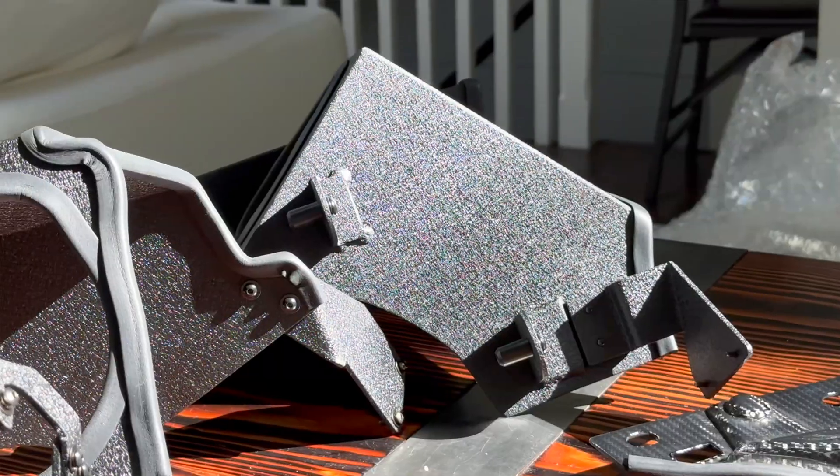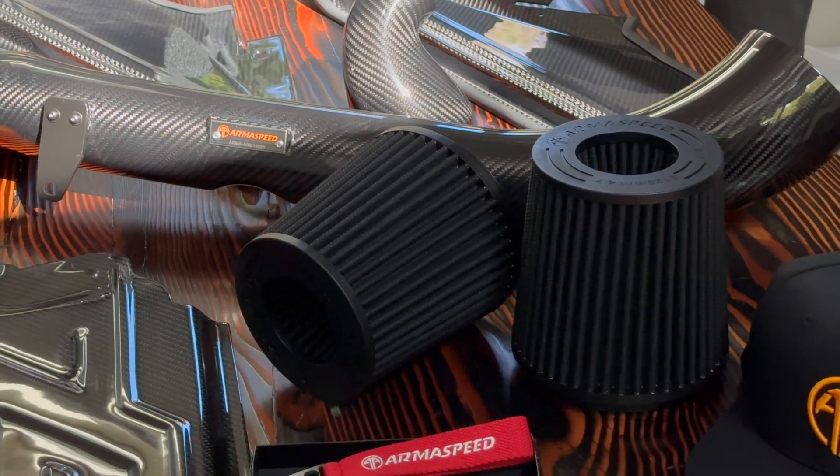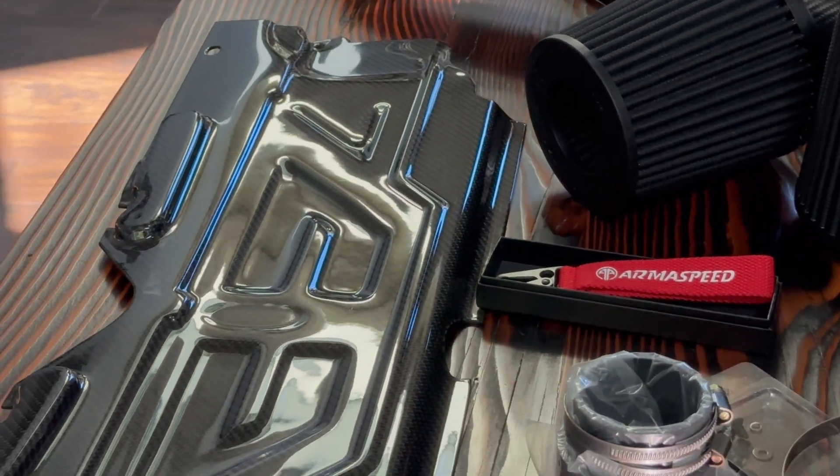I haven't seen a lot of people do reviews of cold air intakes. They talk a lot about the swoosh sounds that you get from the intake, the engine bay enhancement that you get with all this carbon fiber, but none talk about the cold air parts. So why cold air? Why is Armaspeed touting cold air specifically? Well, the idea is simple: cold air has a greater density of oxygen than warmer air. So if you're shoving air into an engine for a given cubic foot of air, colder air is going to have more oxygen, giving you more complete combustion. Theoretically, if the O2 sensor picks up on that increased density of oxygen, it might add more fuel, and you get more power. That's the idea behind cold air.